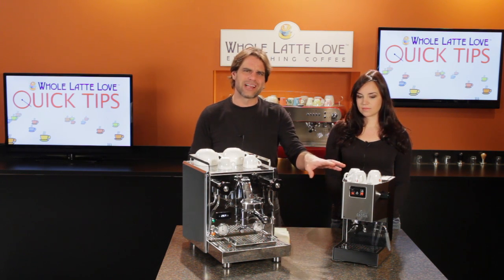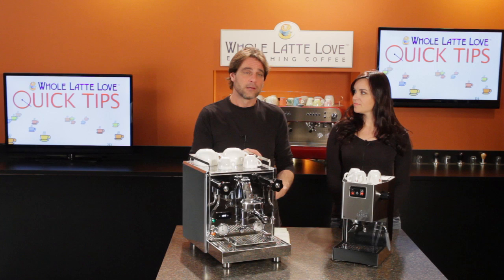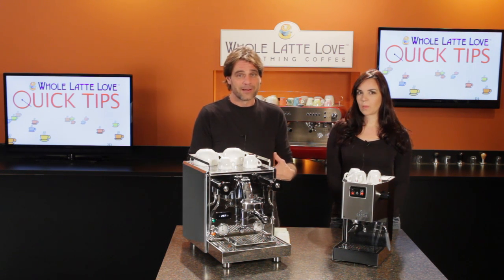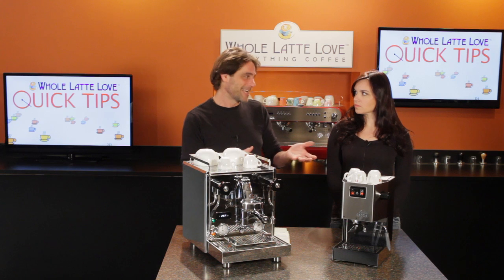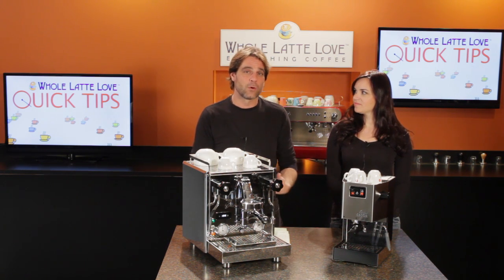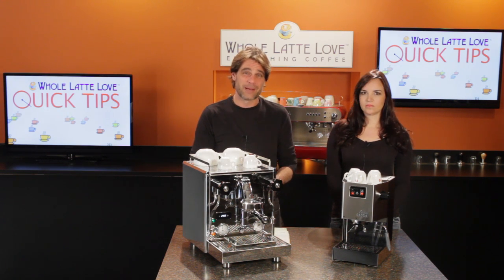Not so much on the Gaggia Classic, but on a machine like a Rancilio Silvia, which has a very large boiler. If you were steaming the last time you used the machine, you didn't refill, that boiler's going to be partially empty. It'll heat up real quick, but when you go to actually pull a shot, you're going to be dumping a lot of cold water into that boiler all at once. Putting cold water on a really hot boiler, bad things can happen.